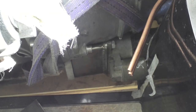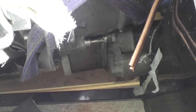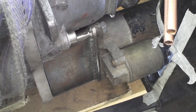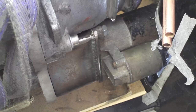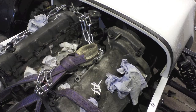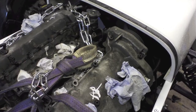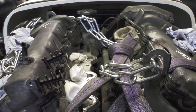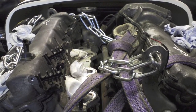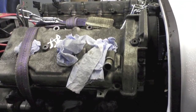It fits in okay. Obviously the height of the engine was going to determine if we could clear the chassis rail — luckily it just cleared. We had to raise the gearbox a little bit but it fits in okay. Once we had the engine at the height we thought, it was best to test fit the bonnet and the nose cone again. You can see with the nose cone on it's all pretty tight but there's plenty of clearance, and hopefully enough room with the throttle bodies as well.